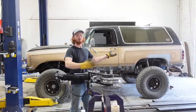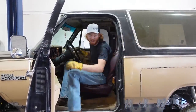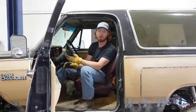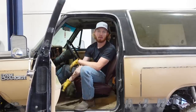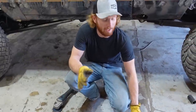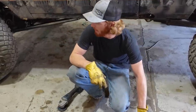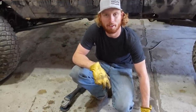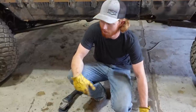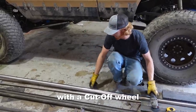We're gonna be putting a roll cage in the Ram Charger today. The plan is to build something that ties into the frame and holds everything together so we don't get any body flex — this thing is gonna be in some rocks. The first piece starts on the floor right here down by my feet and goes up the A-pillar and past my head. The tubing I'm using is DOM — this one is shiny because Janelle shined it up. We decided it would be quicker and easier to polish it than to mask it off and paint it, saving time. It's kind of a vibe.